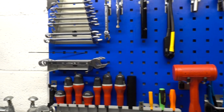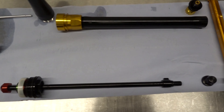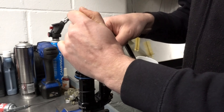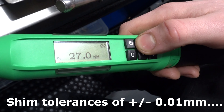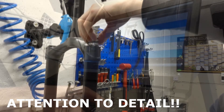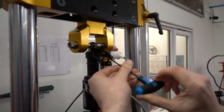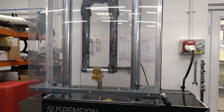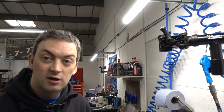It's done on the slot that you've booked, so we only need your fork or shock for that time frame. You don't have to be without your bike for two or three weeks. Shims are sized in increments of 0.05 of a millimeter and need to be accurate within 0.01 of a millimeter. Plus or minus 0.05 of a millimeter in thickness can make quite a big difference depending on the application and how much oil is going through the piston.